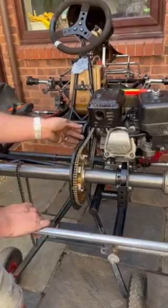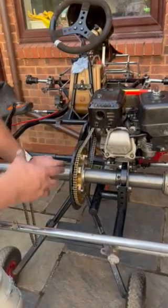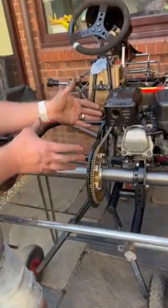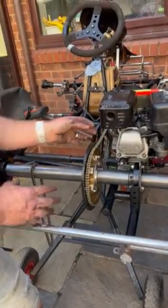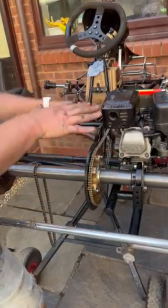Pretty happy with where we are — that one's fine to run, but it will be different for every sprocket we put on. Whether we put a 19 on the front or a smaller sprocket on the rear will affect chain tension. You'll be moving the engine forwards and back to secure the right level of tension, then lock up the clamps and double check it, because securing the clamps will change the tension slightly as the engine pitches when you lock it down.